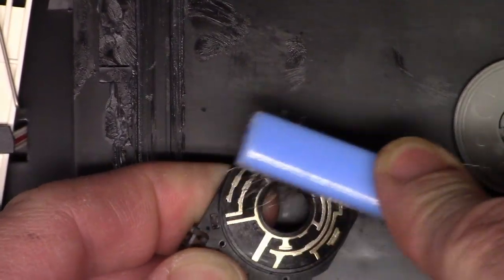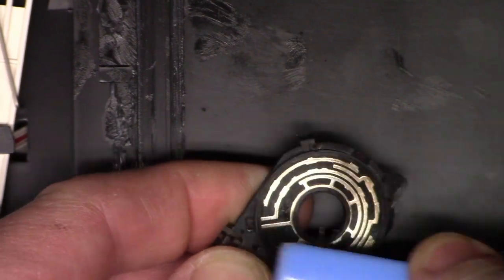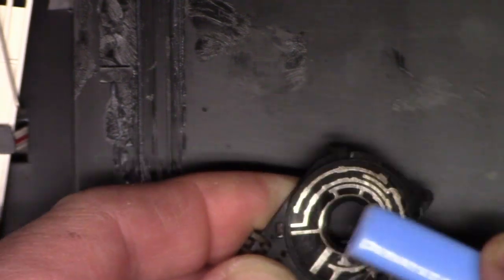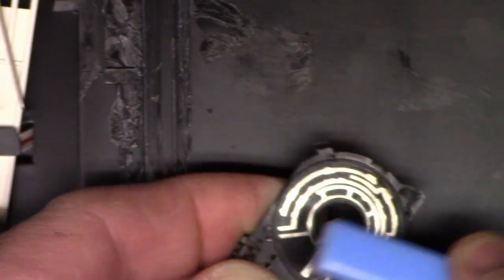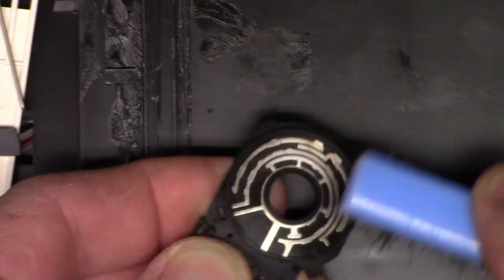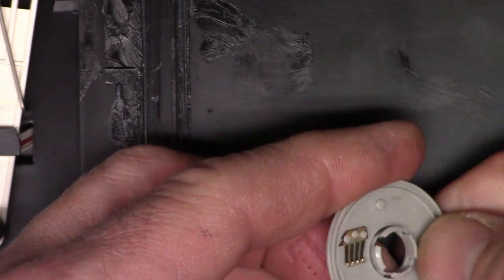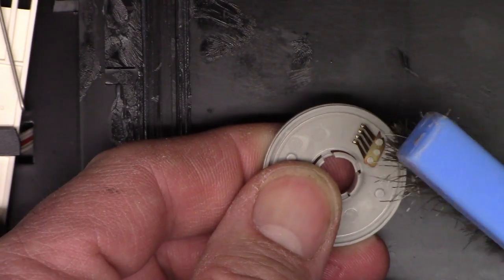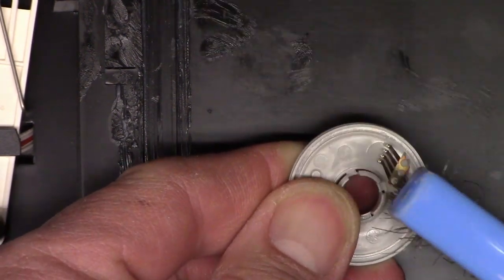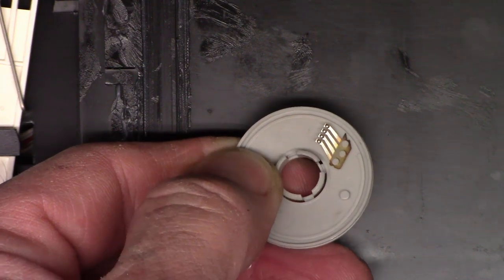So I have this nice stainless steel toothbrush, and normally what I'll do is just brush this — that burnishes up the contacts. You can see the difference right there, how much shinier that is. We're going to go ahead and brush this out. Make sure you hit it in all directions to get it all nice and shiny. The connections are all nice and clean — you can see the tips of them are very shiny now.